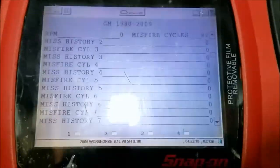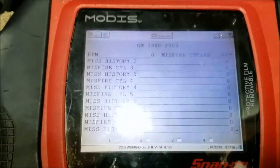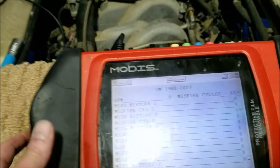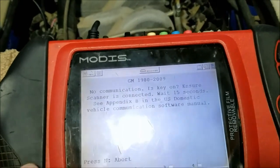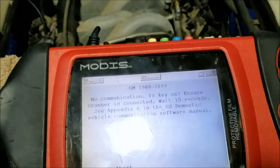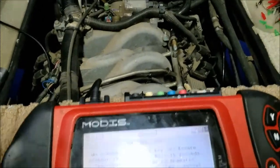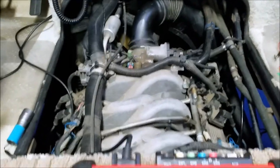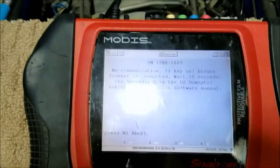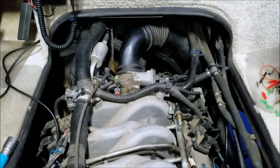It sure was an aggravating thing to figure out, but here's the takeaway: if you've got a misfire and a P0200 check engine light, get yourself a scanner that reads mode 6 live engine data so you can monitor misfires and quickly track down the cylinder. Once you get the cylinder tracked down, then you can determine if it's the injector, the computer, a wire, a coil, or a plug. At least you get started on the right cylinder instead of guessing. I'm glad this is solved. Thanks for watching, have a great day.